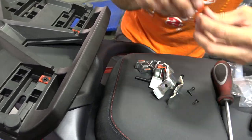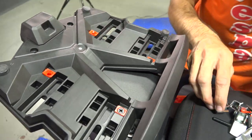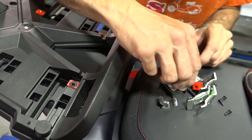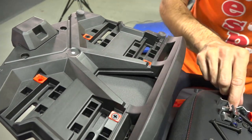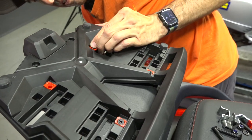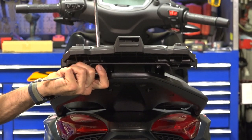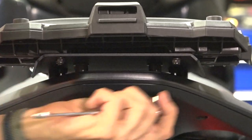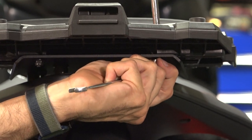Then we'll use another pair of blocks for these holes. There are various different mounting options — but not for this application since the specific mounting rack is pretty well set up. Put the shorter screw in there and use a washer and nylon locking nut that's included. For all the way around, we'll use the shorter screws. Go ahead and put a 10-millimeter combination wrench on these rear-most nylon locking nuts, because you're not going to hold them by hand. Take a number 3 Phillips and tighten these fairly tight — not enough to crack the red spacers.